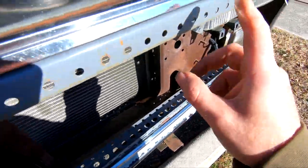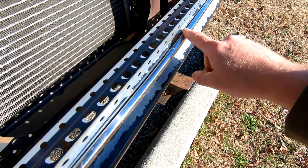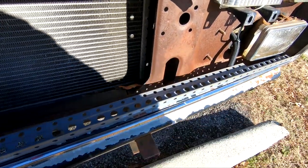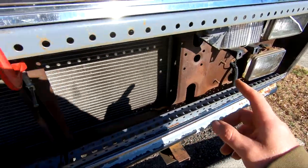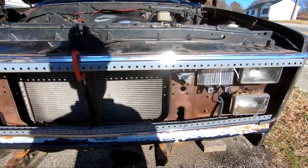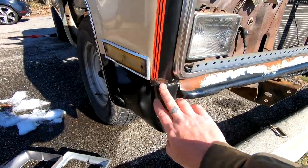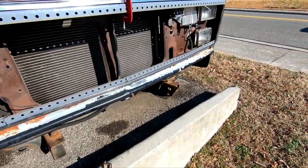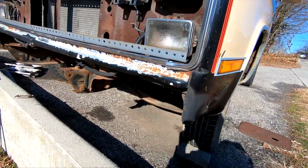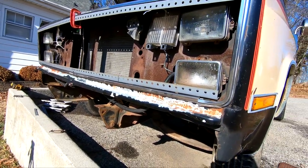I have to do the same thing I did up here — put a relief cut in the middle of this. As you can see from here to there, I got this big space here, so if I relief cut that I could bring it out and try to match it. Let me cut it a couple more times and test fit it again. With the relief cuts in it, it pretty much follows it. This thing is kind of banged up — you can see it's been hit a couple times and it's got a dent in it, so it's not going to be perfect, but that's pretty close. Close enough.